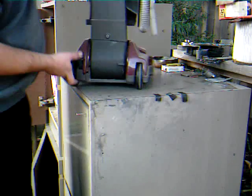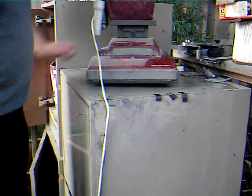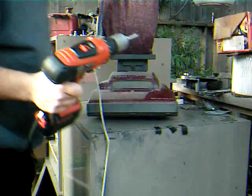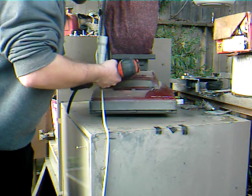Alright, my little handy workbench. First, what you want to start off by doing is removing the cord, just so it's not flopping all over the place. Next, you want to remove the handle from the power head assembly. It's much easier just to have that thing out of the way altogether. There's a screw right here, and there's a nut on the back.